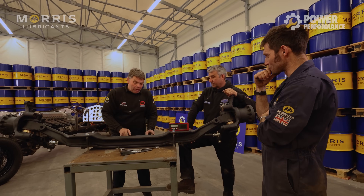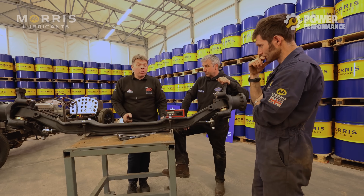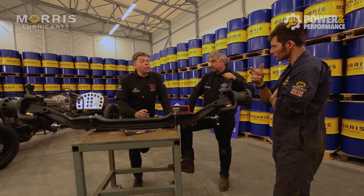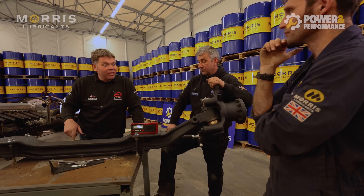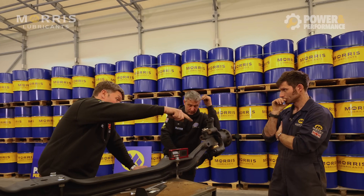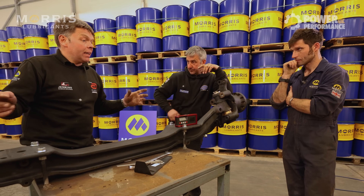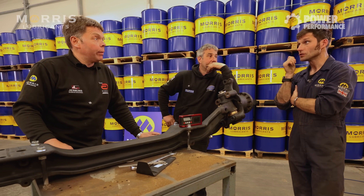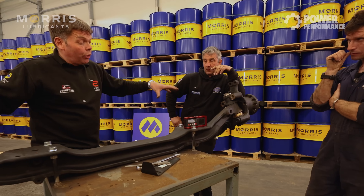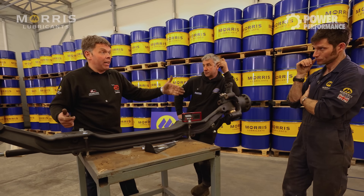How many options have you got? I've got the one setup we've got, plus or minus 30 millimetres either way. What I absolutely don't want to do is go 'this is a load of rubbish' and swap it back to how it was — because it's not legal anyway if you went back. The steering box position can go back to how it was. I've taken the steering box from there to here. I've had to put an eight-mil packer in one rear corner, and I've got the corner weights to within six kilograms now. The front axle corner weights are 3,150 kilos — and I've got six kilos difference side to side with the driver in it.